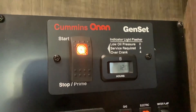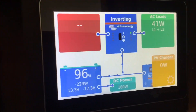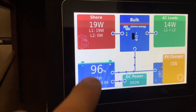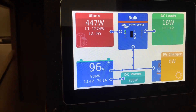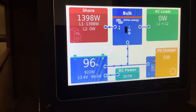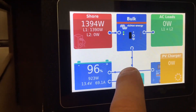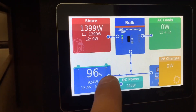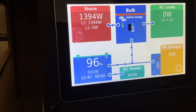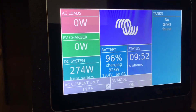When you have a generator, you have an extra backup. Once you start it, it'll take about 30 seconds and then you'll see a red box pop up as shore power—it'll slowly ramp up and start charging the batteries automatically while also powering everything on your AC panel like your air conditioner, microwave, and outlets. It charges at about 100 amps per hour, so with an 800 amp-hour battery bank it will charge in about eight hours. The cool thing is that solar can work at the same time it's charging.